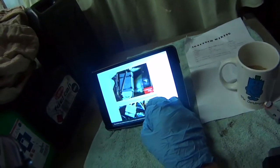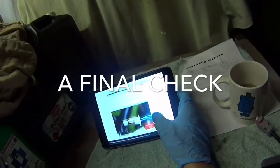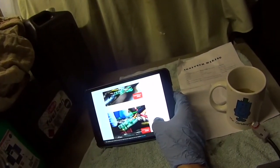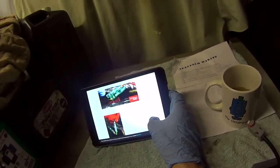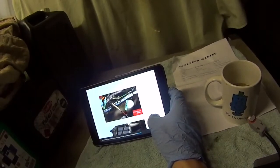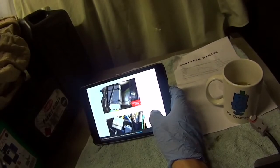Right, so let's just double check we've done everything we should have done. Ignitech white goes to yellow, going to left coil. I've checked that the yellow goes to left. Hook the ignition green to the black and white, done that. Okay, so literally just plug the Ignitech in.